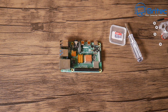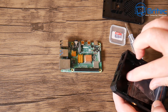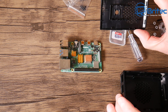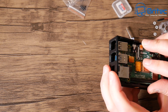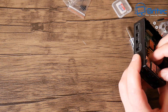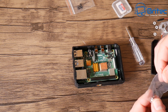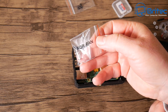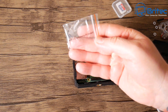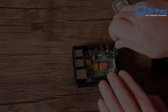There's nothing wrong with it as a starting setup. Now all we need to do is put it inside this little plastic case. We take out the screws and get the board seated into the case - pretty straightforward stuff. Just push it right up into the ports so you don't have any problems screwing it down. The labels on the screw bags tell you which screws are for the computer and which are for the fan. It comes with a little screwdriver, so just screw those down and we should be good to go.